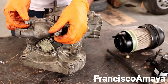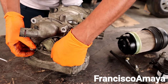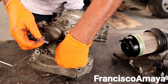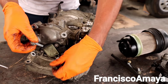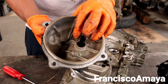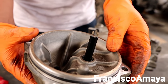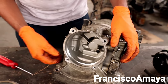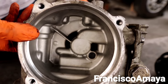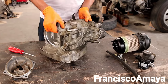The fuel water separator area is going to be under this filter right here. This filter is going to have fuel water separator capability, so you're going to have water separation in case fuel is contaminated with water. You need to know when there is water in the fuel, and that's the reason you have a sensor here. This is the fuel water separator sensor — it has two pins that connect when there is water in the system.